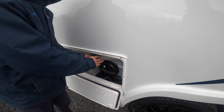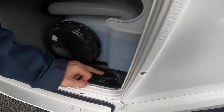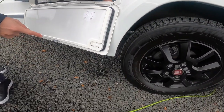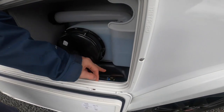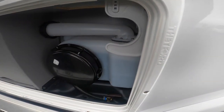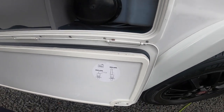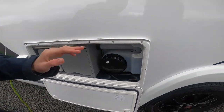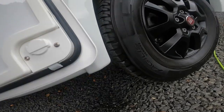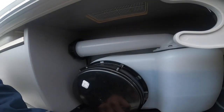If you have a full tank of water and want it a little lighter for travel, you've got a little drain tap here called a travel drain. Opening this will make the water come directly out underneath the vehicle, but you must have the pump on — without the pump on it won't push the water out. Turn the pump on to eliminate from a full tank down to a remaining 20 litres, so you've got enough water for a longer journey and can still stop to use the toilet or have a cup of tea. To drain it completely, you've got to get underneath the vehicle to a little black bung, which is a 15 mm compression fitting on the end of the hose — just pull that off to drain the full tank or the remaining 20 litres.